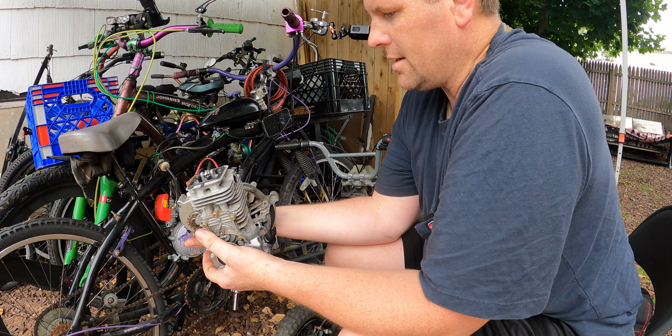It has a connecting rod, wrist pin, piston, crank, just like in a two-stroke. All that stuff is basically the same. The difference is with the valves. Now, this one wasn't working because the exhaust valve, this valve here, was stuck open, so it wasn't making any compression. The reason this happened is there was low oil for one, and two, the oil was never changed, and then they rode this thing a lot and beat the snot out of it without taking proper care of it.